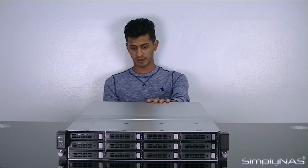That's always great to have, especially in the data intensive when we're downloading, let's say, a terabyte of data. The SSD cache will definitely help with that. So consequently the same with the write as well. If you've got a lot of data writing to the NAS, 4 SSDs are generally ample extra capability to help speed up those transfers.